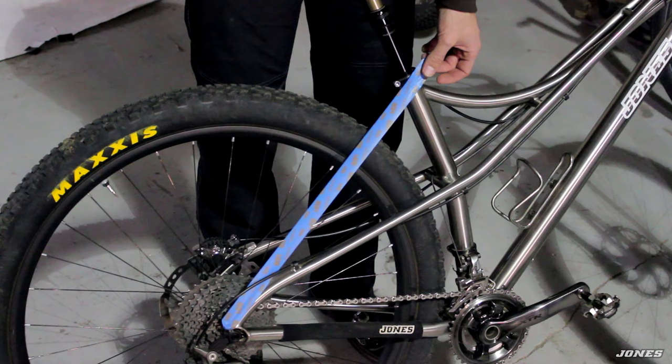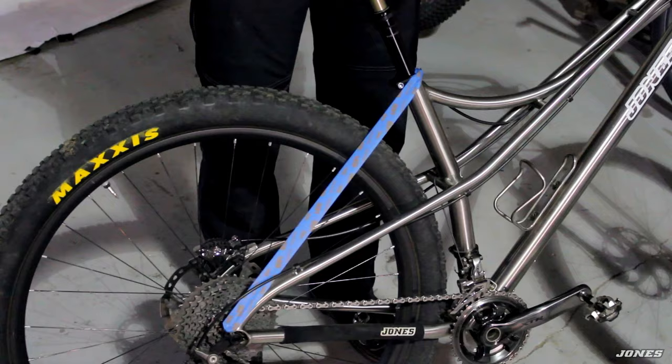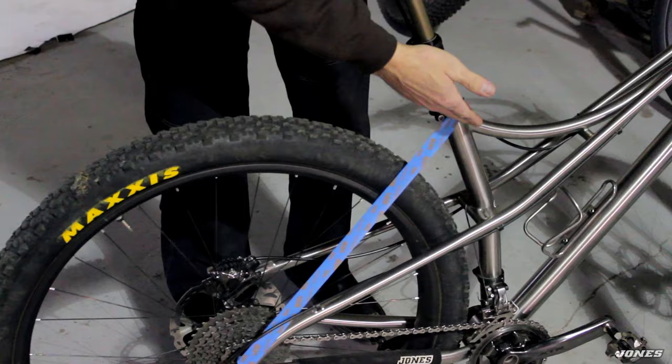This piece of tape will represent the seat stay that would have been here if this were designed more normally. This will show that when I push down on the seat, you'll see that flex — just push a little bit, you can see it moving. If I push really hard, it drops a lot. So this is indeed the distance from the rear axle to the seat post clamp shortening. And of course, with a seat post that's extended a lot, this also gives you more flex. I purposefully designed the bikes with a smaller diameter seat post so you get a little more flex out of the ride when you're seated.